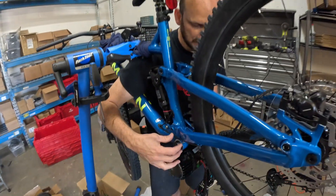I noticed this as I was editing — there are two different ways you can do this. Normally I'd recommend bumping the motor all the way against the frame as much as it'll go without hitting anything, and then putting spacers on the chain ring in between the motor and the spacer. You could do it either way; it doesn't necessarily affect anything. The only reason I'd say do that is so you still have threads to put that inner lock ring on. If you have plenty of threads — like we do — you just won't be able to put the outer lock ring on.